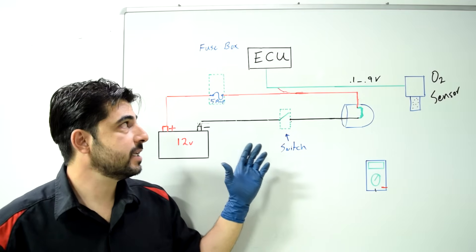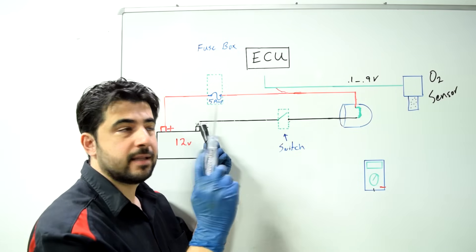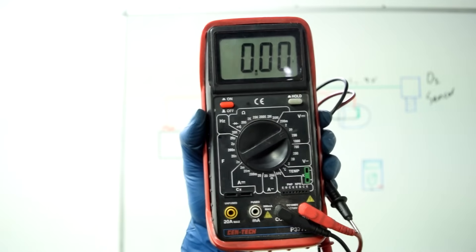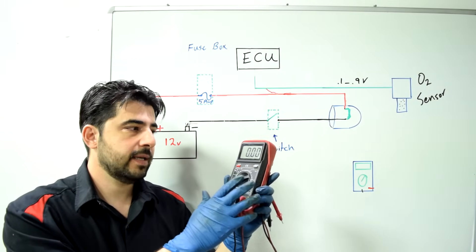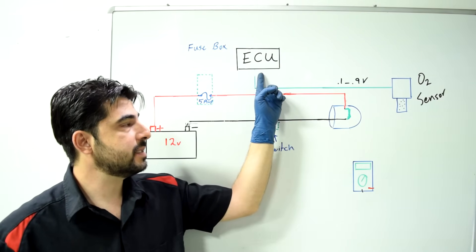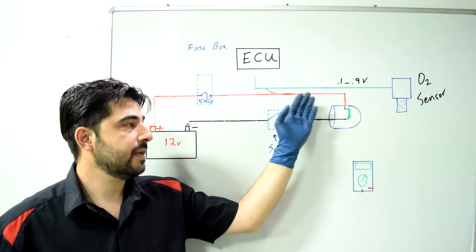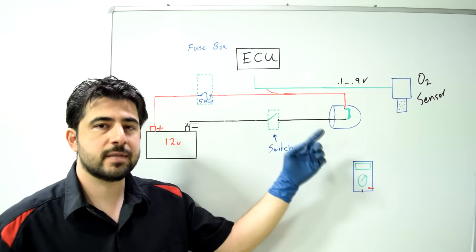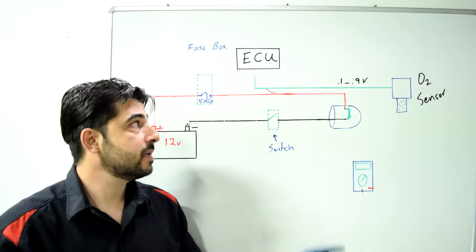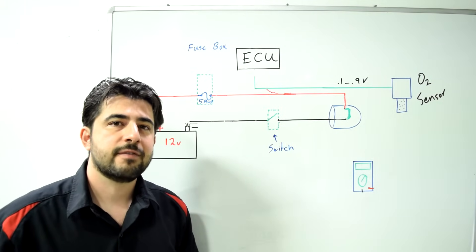The way you can go about diagnosing this is to disconnect the connector at your ECU, grab your test light, connect one end to the negative side of the battery, and touch the other end to the signal wire. If the light lights up, that means you are shorted to power. Also be careful — what you don't want to use for this test is a multimeter, because depending on what type of multimeter you use, you might get a voltage reading even though you don't have a short to power. That reading is basically what's called ghost voltage, which is when you have many different circuits and wires run side by side in a wiring harness and as different circuits become activated and deactivated, that creates a magnetic field which can cause a voltage reading on your multimeter. But if you use a test light, it's not going to light up with ghost voltage, because you obviously need actual current for that test light to come on.